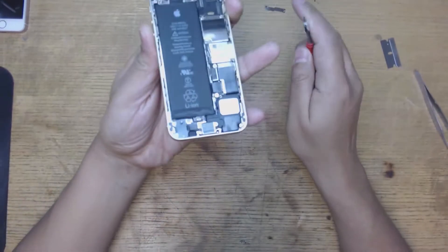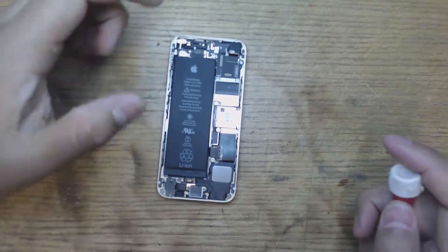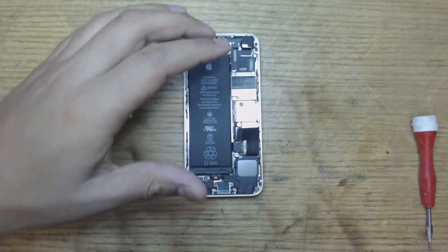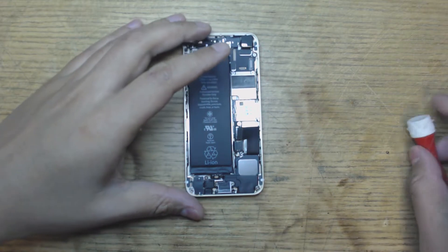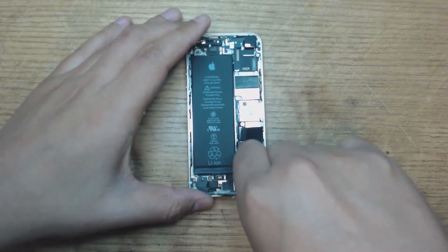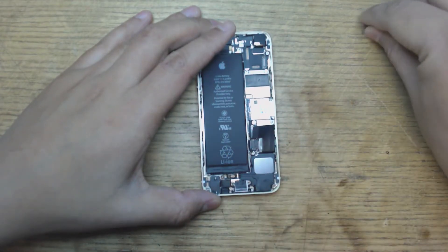We've got the phone here. The charger port is basically all these screws — it's underneath the speaker and it connects right here. First unplug it, then unplug the little battery and unplug the antenna. There's a little plug here for the antenna — unplug that. Then we remove the screws. I put these screws down in a way that I know where they go after, because it gets kind of hectic if you don't know where they go, so I line them up.